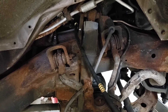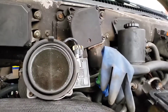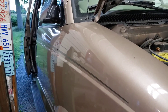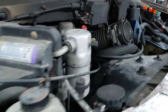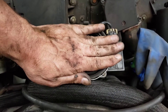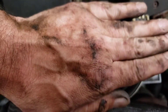I opened the valve on the compressor and started pumping air in. The glove on the oil filler never moved. The glove on the tailpipe never moved. There was no air escaping into the neighboring cylinder — number four in this case. The culprit is right here: the air is escaping past the intake valve and coming back up the intake to the throttle body and air intake. Come with the camera even closer and you can hear it.